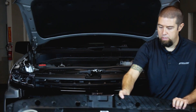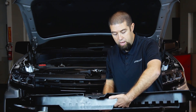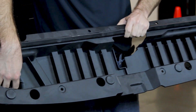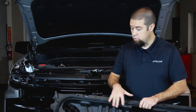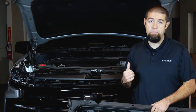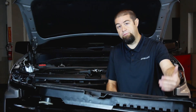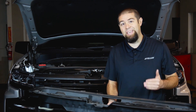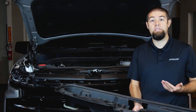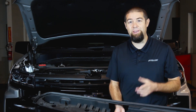This inlet here is the factory diesel 2500 air intake, and as you can see, it has a scoop system right in here. It works its way through the latticework type material and into the intake system. On the diesel trucks, the intake is on the passenger side of the vehicle, whereas on the gas trucks it's on the driver side. The concept is the same — you have a scoop system that allows for fresh air to come in, but on the diesels it doesn't get affected by the heat of the radiator system, while on the gas trucks it does. This basically confirms that our concept on the gas trucks is exactly what Chevy did on the diesels.